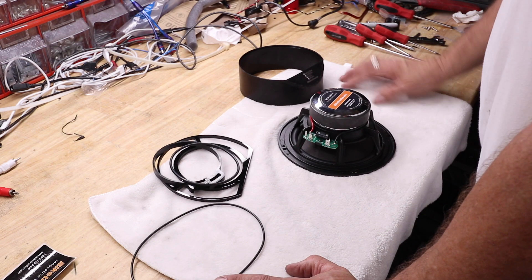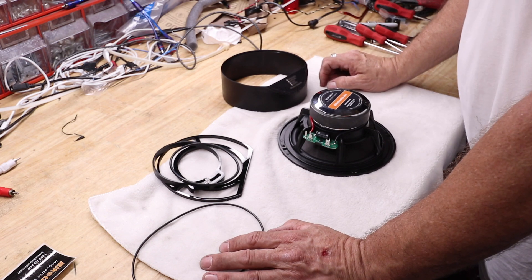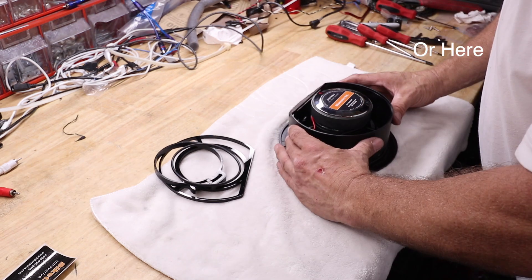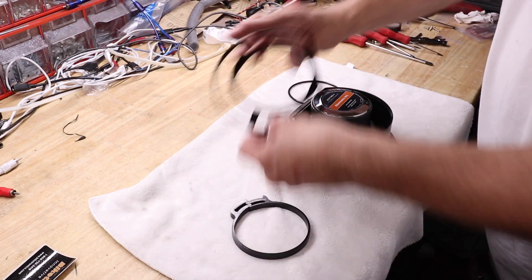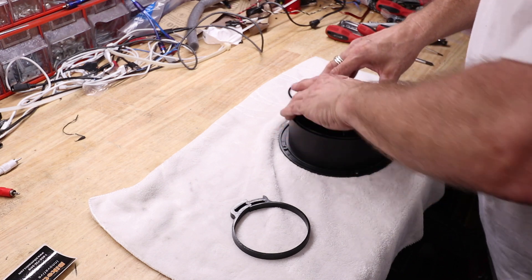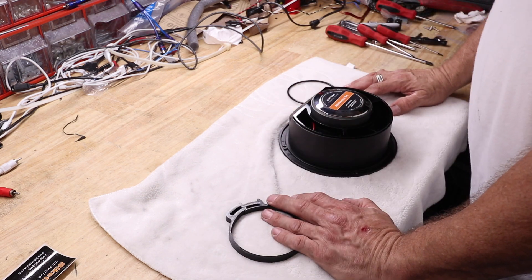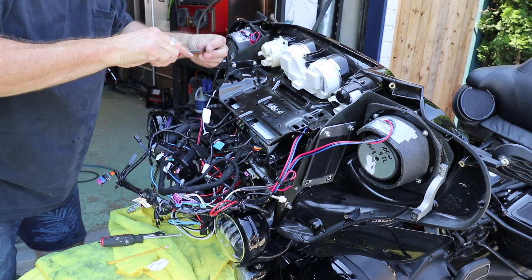This is the Aperiodic sound system by Biketronics. It's fully metal, it's heavy duty. What it does is it tricks the speaker into thinking that it's in a large sealed enclosure by using what's called Aperiodic loading. What this does is it helps suppress the peaks and it smooths things out at the lower frequencies. So it keeps the woofer under control, tightens up the mid-bass, makes things a little punchier, and you get the open back to help keep the driver cool. If you want to get the same results without spending big bucks, these are the boom mat speaker baffles — I just cut the backs off them to help keep the drivers cool, but they work on the same principle of the Aperiodic loading.